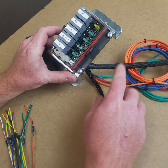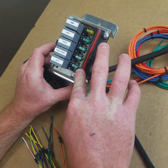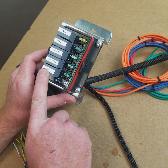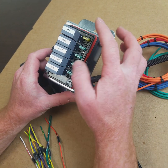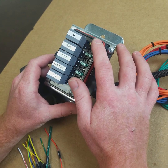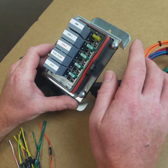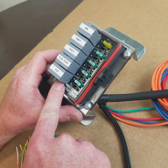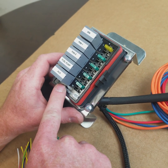It's a pretty simple construction. You can see our 5 fuses over there, and each fuse corresponds to a relay located right next to it. This top ignition relay is fed with a 20-amp fuse, and what it does is energize all the other relays in the box — none of them will come on without the ignition relay energized.